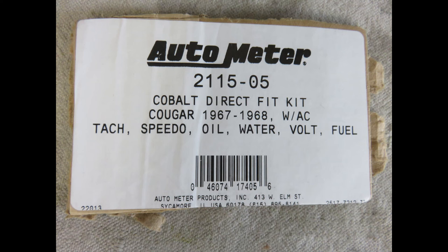I still couldn't get the gauge to do what it should. At one point I bypassed everything, and it was reading absolutely 100% backwards — when it was empty it showed three-quarters, and when it was full it showed a quarter tank. I finally broke down, did a lot of research, knew what gauge I was supposed to have, and called AutoMeter — that's who I bought the gauges from, a complete package for the Cougar. They said 6-1-1-5 is the gauge you're supposed to have.